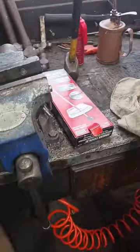But between the top lip here and right here, there is a little space. So what I'm thinking is if somehow, because your painted surface that is on that gasket that goes for it just metal to metal, that painted surface is meant to stop any oil from coming out, right? It's its own type of sealant. Well, I'm just kind of taking a little bit of the gasket sealant and just filling that little void. See, this is flush. That's flush. I know it doesn't look like it, but that's flush, and there's just this little space.